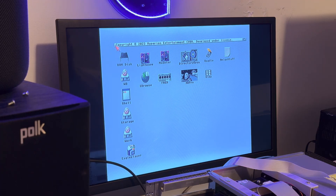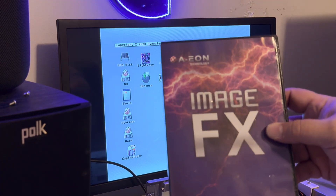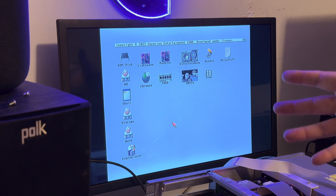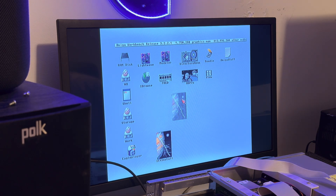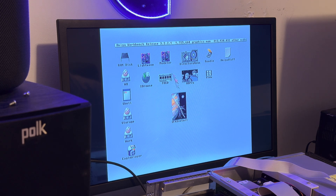It's booting. Hey, look at that - you can't see anything. Okay, look at this. I know it's far away and the color temperature just changed and it looks garish, but look - we booted. It works. We have a CD-ROM drive. Matter of fact, we can test it with a CD disc. Remember this that made an appearance earlier? Press the old open button and we should see any second now an icon on the workbench - the desktop, queue. How dare you? Hey, look at that - Image Effects install. And what do you see up here in the corner? 413 megabytes of RAM. We can click on this guy here - Icons, Eject Disk - and out she comes.